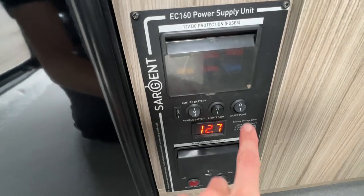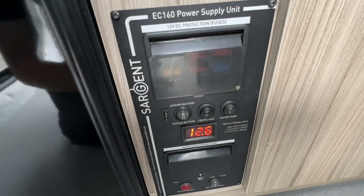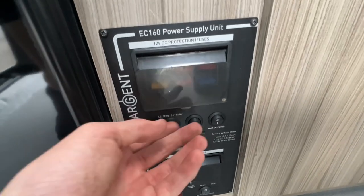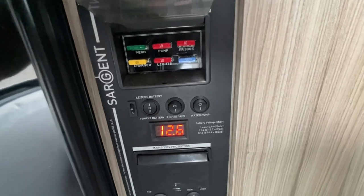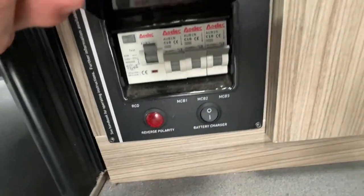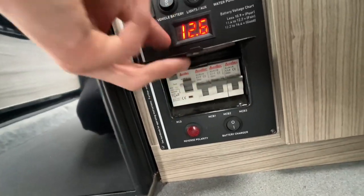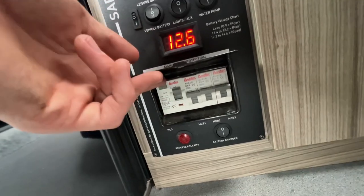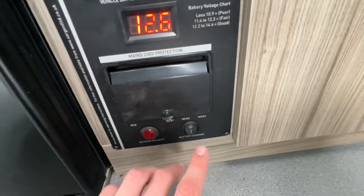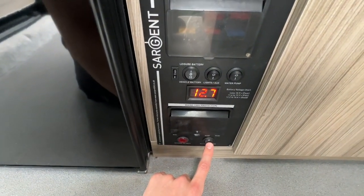You can turn your lights on and turn your water pump on — it'll start to pressurise and then go quiet. As soon as you open the tap it'll kick back in. All your fuses are here, so do carry some spares. You also have your main trip switch — if you're on mains power and think you're not receiving power, try here before messing with the cable. If the vehicle trips you have power; if it doesn't, it's probably a cable. This also turns your battery charger on, which charges your leisure battery and kicks the fridge in — it's the main on/off for the fridge as well.